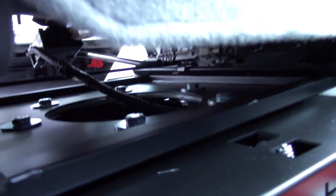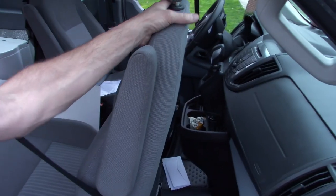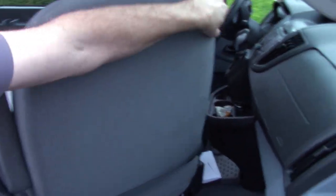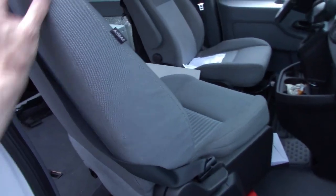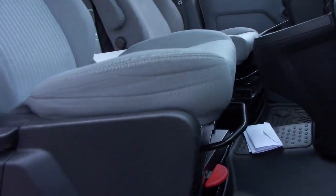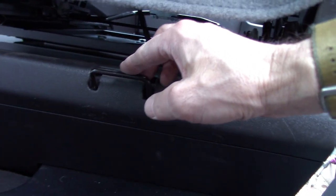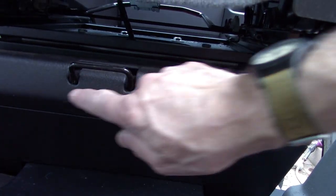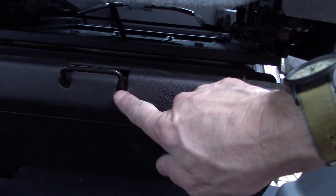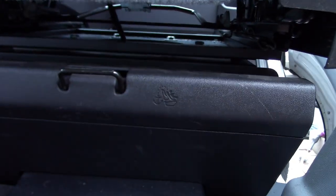Reconnect your airbag connections and replace the battery wire. Here it is swiveled all the way around. Don't go all the way around 360 degrees because you'll twist that wire underneath and you'll have some issues with your airbags. Here it is bent down with the plastic trim back on — it still clears the plastic trim and when you swivel it the seat base misses that metal bar.